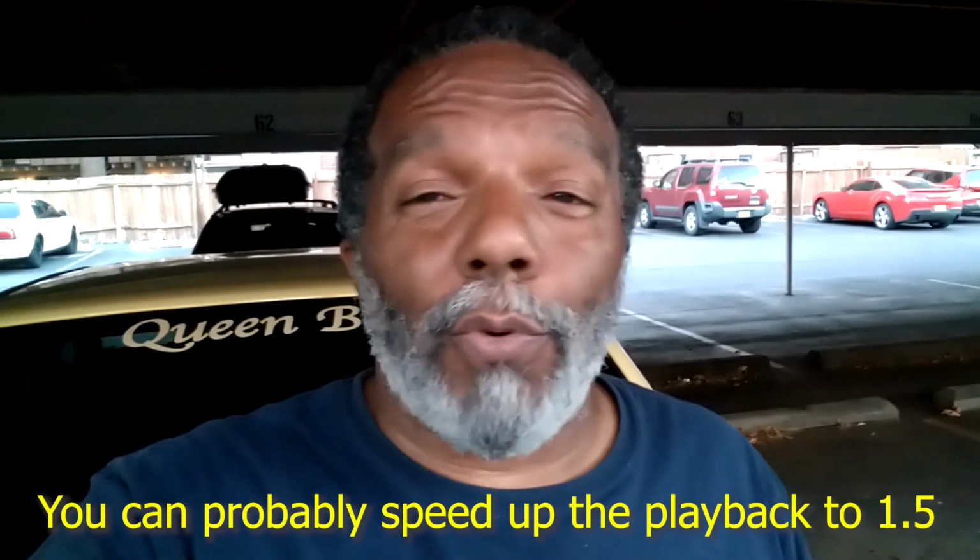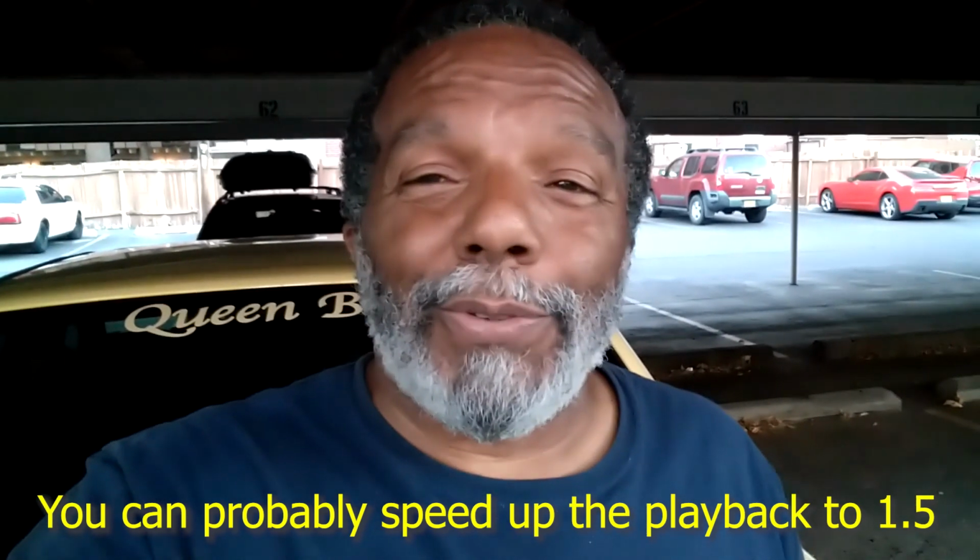Making this video for a guy that has a 2002 S80. Now, this is going to apply to a lot of you people that are fortunate enough to have newer cars, bells and whistles, all that good stuff. Unfortunately, the car has a network, like a computer network. It's got 3, 4, 5, 6, 7, 8 computers that are networked together. They have to communicate with each other. They ask each other questions, get answers, send information, receive information. And like your computer at home, when that network connection is compromised, usually by low voltage, battery dying, people not driving the car, every once in a while one of them computers stops communicating clearly, and that thing needs rebooted.